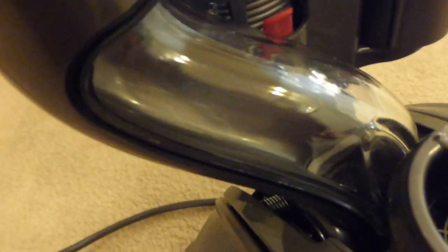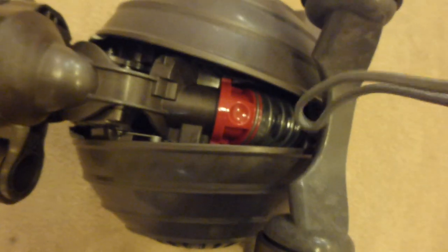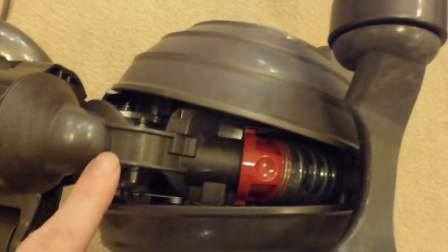On the back underneath the bin, we have our clearance port - this is basically the anti-blockage port. It's got a clear front but this one has a screw, so you need to remove that screw to be able to take this off. Blockages from the floor head which are inside the ball are going to be in this internal hose. To remove a blockage, turn the cleaner over onto its back, lift this up, and then you can get down into that little hose to remove your blockages. The internal hose comes up to a changeover valve which decides whether it's going to come through the hose or from the floor head - that's done automatically, as on previous models.